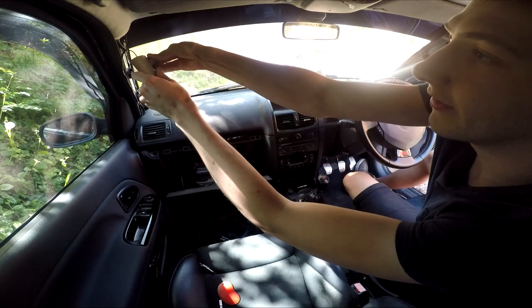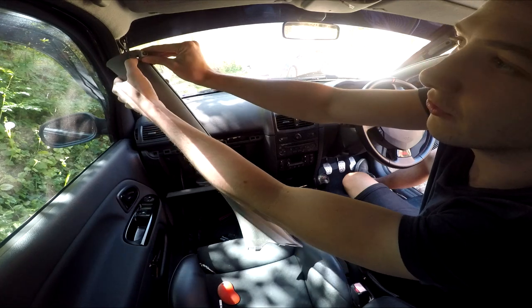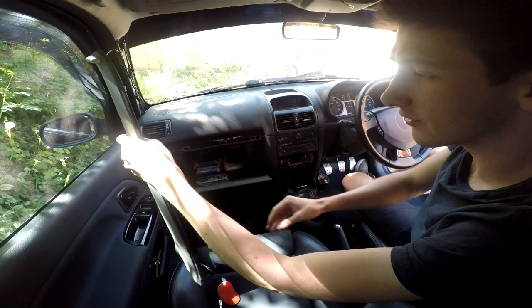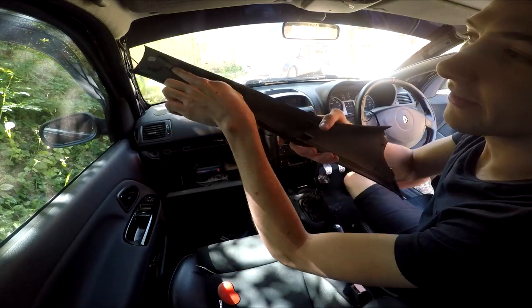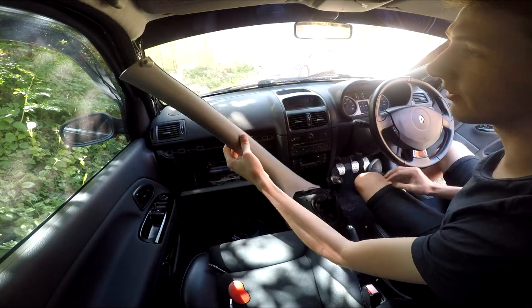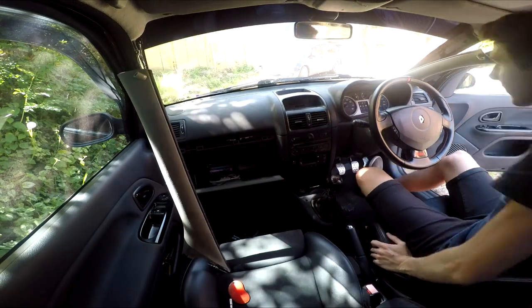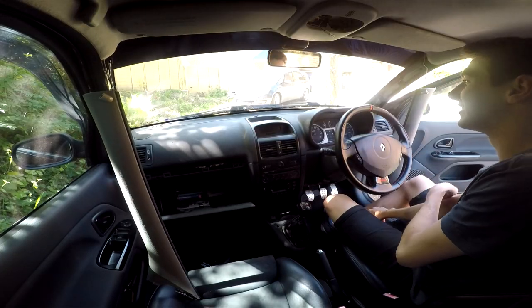That does pop up and it reveals a little screw in there that you can take off, but hopefully I can just leave it sort of hanging off like that. One bit to pick up on is there's a P-clip. Squeeze the P-clip in so you'll be able to see it from this side. Just push and squeeze and then it will pull off, the rest of it will wiggle out, but hopefully I can just leave that dangling there. Same on this side. Now they've left a reasonable amount of wire, so that was ideal.